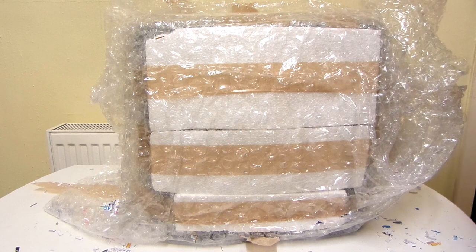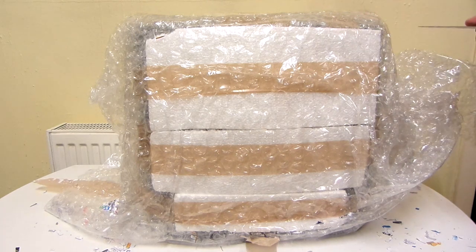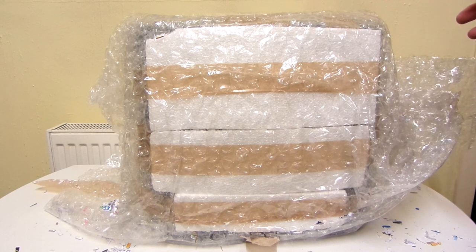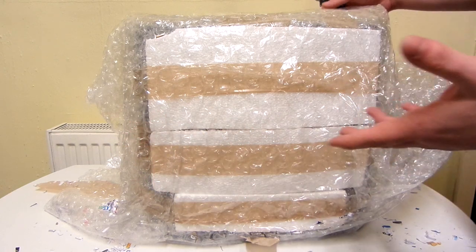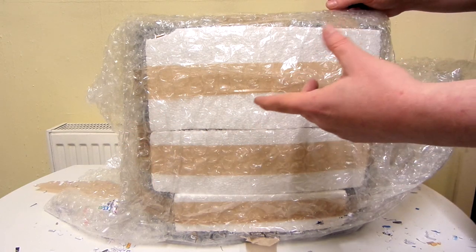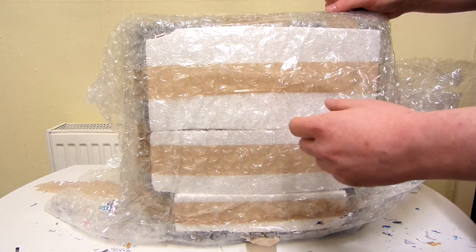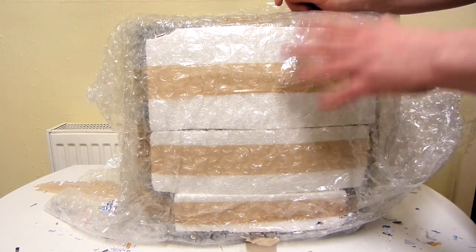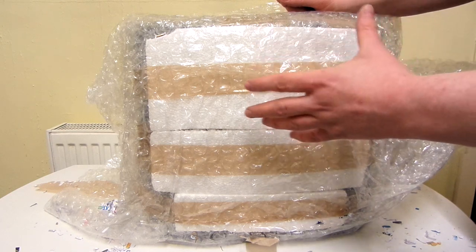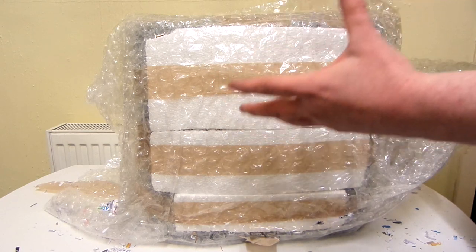There are two things I look out for when buying a CRT off eBay, as I've experienced these problems a few times in the past. One is a slightly squished screen — it's squashed in one direction — and while most of the time it's not noticeable, if you see something on screen that should be a perfect circle, like a car tyre, the wheels will actually look a bit oval. So when buying a CRT on eBay, I make sure they have pictures of the TV switched on so I can gauge whether the screen is squished.